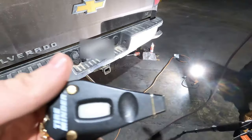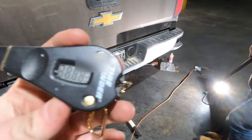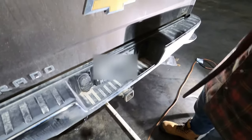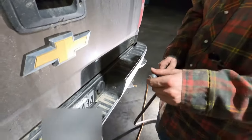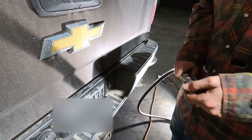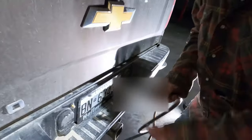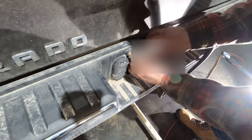Okay, so we just have a little electronic gauge here. Just press one button to turn it on, it automatically calibrates. It is accurate, we have tested it. The thing to note with this is, with any kind of compressed air system that's usually around 120 PSI, it only takes about a half a second and you've put 20, 30 PSI in these things, so we don't want to do that. So we're just gonna...